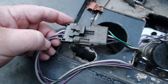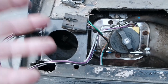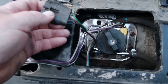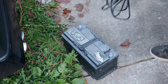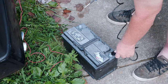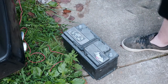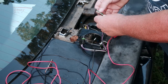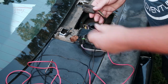We're not concerned with that because what we're doing is troubleshooting. To save some time in the troubleshooting process — since this is already clearly jacked up — instead of checking the relay and the fuse I'm just going to go ahead and check for power here and see if this is working the way it's supposed to. First thing we want to do is take our test light and make sure it works. The wires we're concerned with are the black wire and this tan-brown with a white stripe wire.